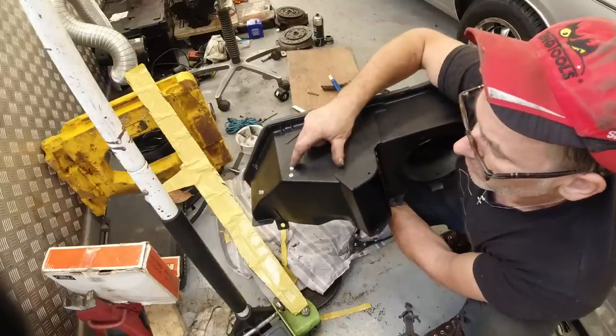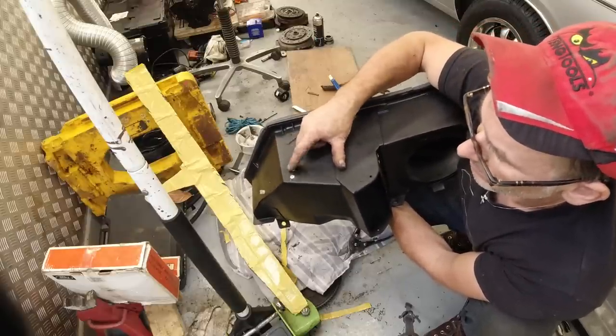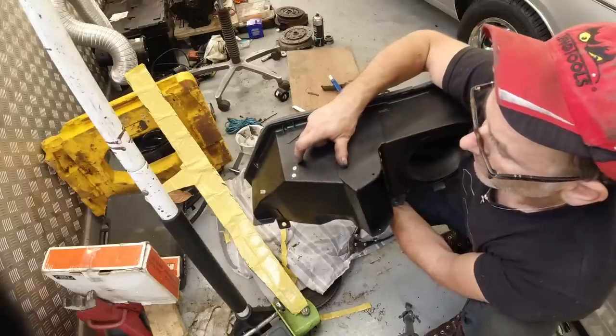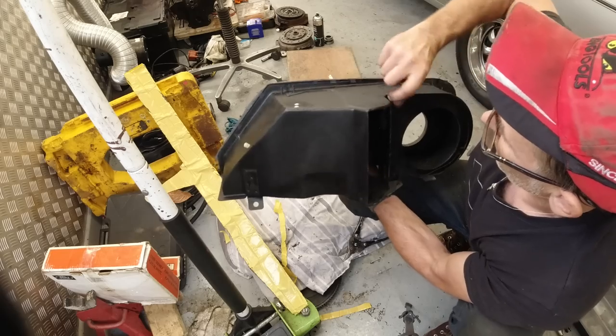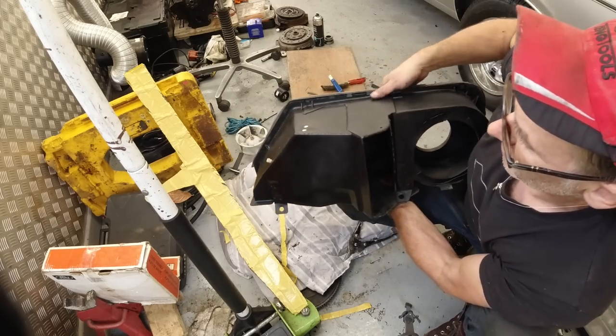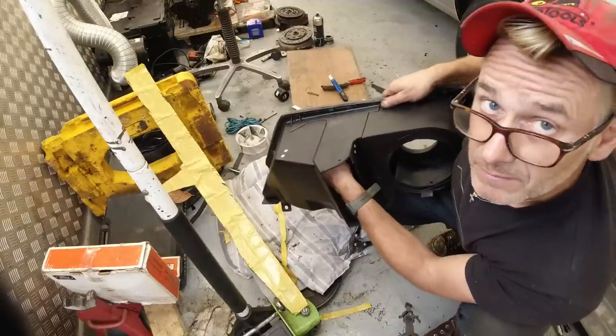So if I drill both those rivets out now, once the silicone's cured, the plate would stay in place, ready to take the bracket and the new set of rivets. Or you could rivet one at a time, take it easy. But that's future-proofing it with some support brackets. You could actually add them on your car if you want to. By taking the matrix out, you'd get your hand in there.